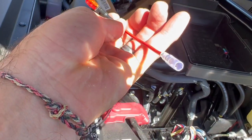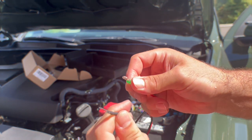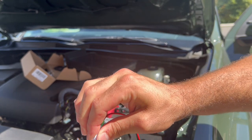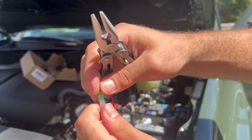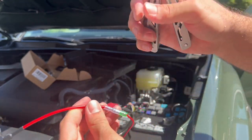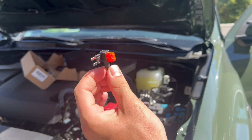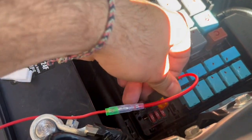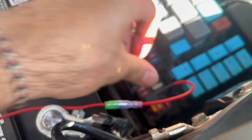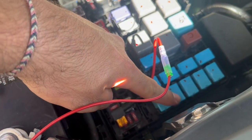Take the fuse we just popped out and place it in this socket right here. There are two pieces and now we're going to connect this little strand to this right here — all you do is basically shove it in there and clamp it in place. This one is going to be grounded, so take this red one, put it right in here, push it all the way in, and clamp it in place by pushing this little green part. Now put it back in the same exact spot you took the old 10 amp fuse out of — go ahead and twist it a little bit to the back and pop it right back in place.